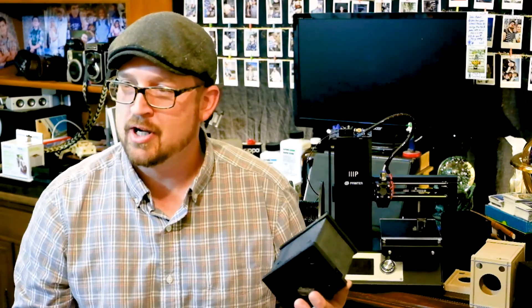This can seem a little tough when you get right into it, mainly because — how do you know it's going to print right? Doesn't the print shrink a little bit? When I started printing I originally thought it did shrink because of things I was reading on forums, so I was increasing the scale of the print. But what I found out was that that was completely not necessary. Cura, the software that ships with it, was able to accommodate that and actually printed just fine. Then I found Cura version 2.4 or whatever the newest version is, and it works even better.